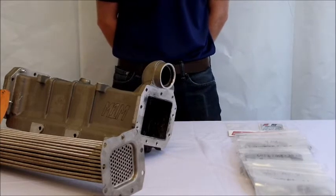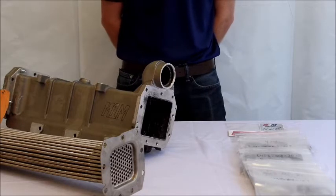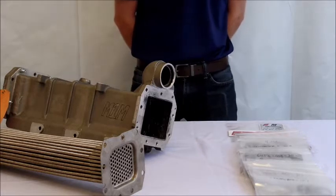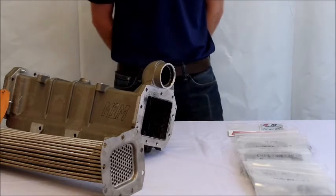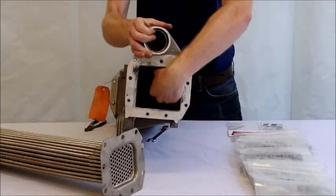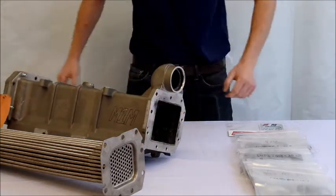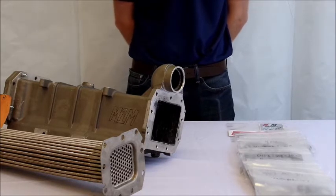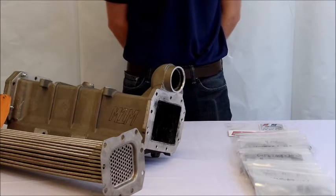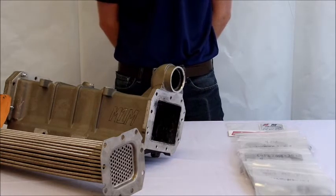After this step, check the inside of the EGR cooler body and make sure there is no debris or buildup from the old EGR cooler insert. If there is buildup on the low temp side, inspect the low temp cooler and clean it out if necessary. Note that we do not provide a gasket if you remove the low temp cooler, so you will need to purchase one if you decide to do that step.